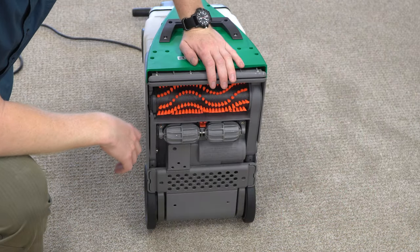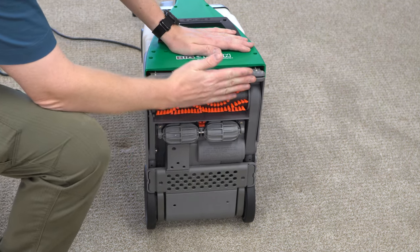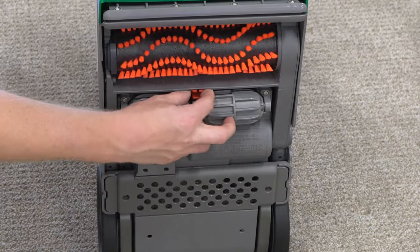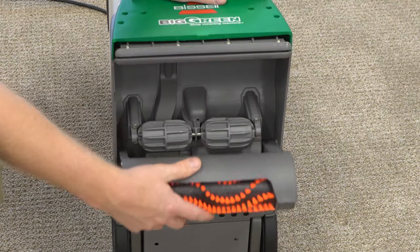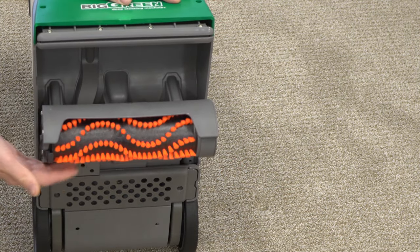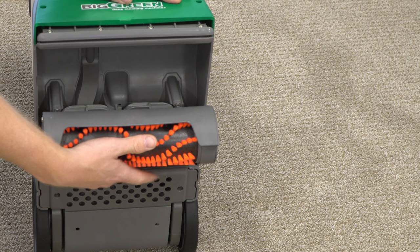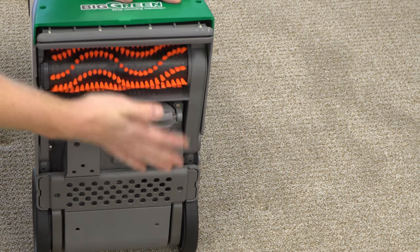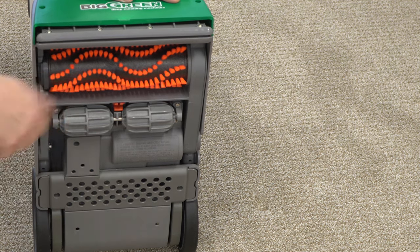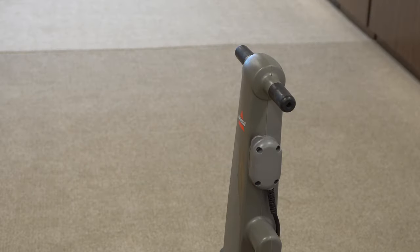I want to show the bottom of this off. This is one of the few carpet cleaners supposed to accommodate higher-pile carpet. You have a spring-loaded nozzle, a free-floating brush roller, and a set of heavy-duty wheels. The brush roller comes down and if you need to clean or change it, you can. This is a lifetime belt, so I wouldn't expect to have to do much with it. It's just really well-built. The exhaust is directed into the bottom, like just about everybody else — and if this were a Hoover, they would call that heated.